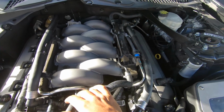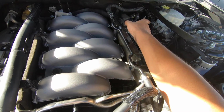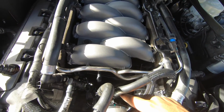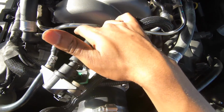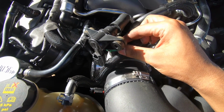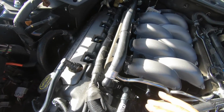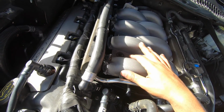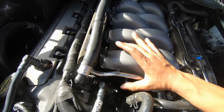So let's go over that again. As you can see, you've got the stock routing to the brake booster. You follow it up. You took that piece that had the clip on there off of the aspirator, put that in here. This one was the one that we cut in half. That goes into the bottom of the purge. Then the one that we took off earlier that had the green clips on it goes into the side of the purge, and then you have the power. And that's pretty much it, guys, with the lockouts. On these manifolds, you don't have to cap this off, but it looks better to me. I'd rather have it capped off. It just runs through back to the IMRCs, which we don't have anymore.